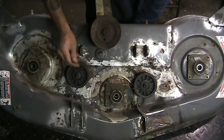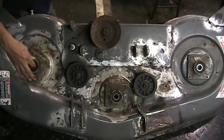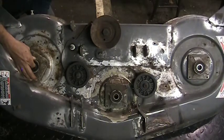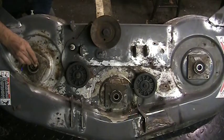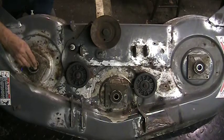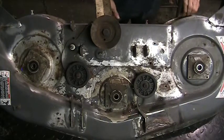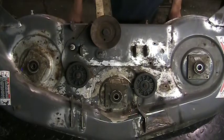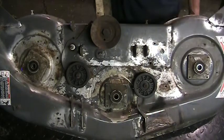This spindle still has top and bottom bearing and its spacer — you may be able to see it moving around in there. This one also has both bearings and a spacer, with bunch of twine tied around the bottom. That will overheat a bearing real quick. It's bailing twine — orange nylon. That will overheat and cook a bearing. I've seen it many times before. This is the most repairs I've had to do on a deck — I don't usually get into patching them. But it's a nice tractor and the rest is in really really good condition, so it was worth spending more time on it.